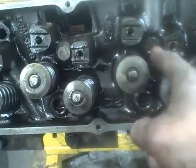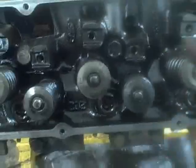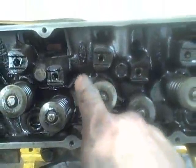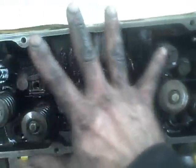It's really simple, but the reason it does that is you always start from the center. If you can't find the sequence, you always start from the center. Usually you'll go 1, 2, 3, 4, 5, 6, 7, 8, 9, and 10 — working those bolts in a circle. What that does is when you set your head gasket in there and torque down your bolts, it actually spreads that head gasket out instead of tightening here and bunching up — it spreads it evenly, so you get no chance for any ripples.